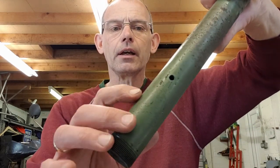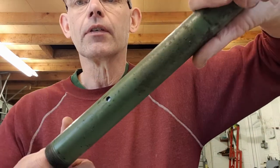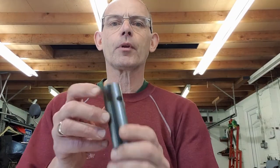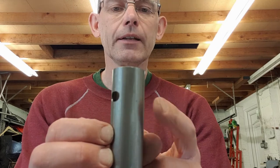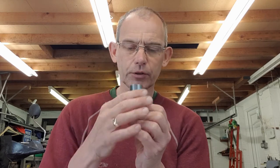There is a grease nipple position on these forks - there's no oil, it's a grease-based mechanism, so you need to grease these regularly. With the spacer in position, that little hole gets filled up by the spacer. The solution was to cut a nice little slot in the spacer - I did it on a milling machine but a hand drill will do. That slot needs to line up with the grease nipple. The grease nipple protrudes through the fork leg slightly, which will actually stop the spacer from spinning, so the hole will always be lined up with the grease nipple.